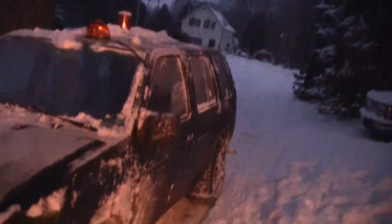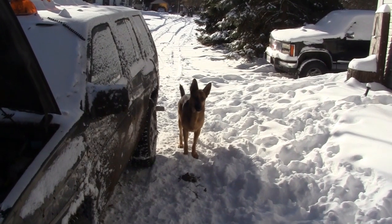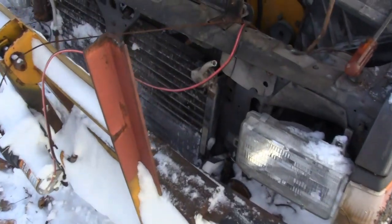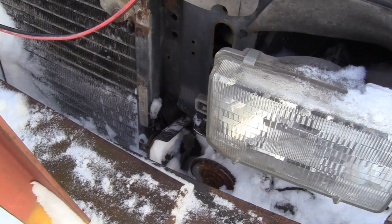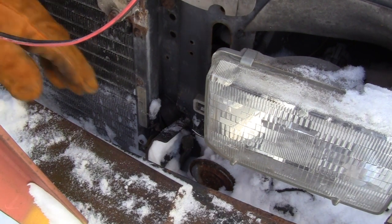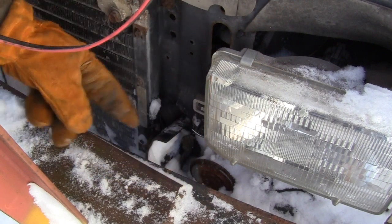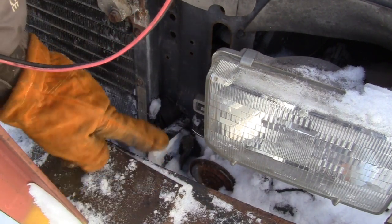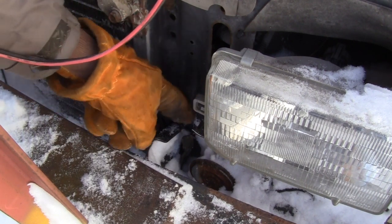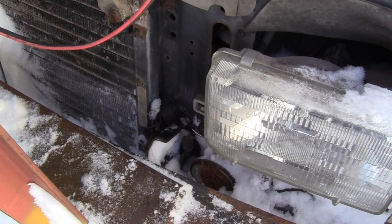I only got a little bit of firewood because I want to take the seats out of the back. All right. So all this has to do is hold the weight of the plow, and that's the problem — I've got no shocks in the back, it's been bouncing around, so it's ripping itself out of the bumper here. I need to go from here into this bracket right here, and then possibly up into the body part here. There's not a lot to weld to.